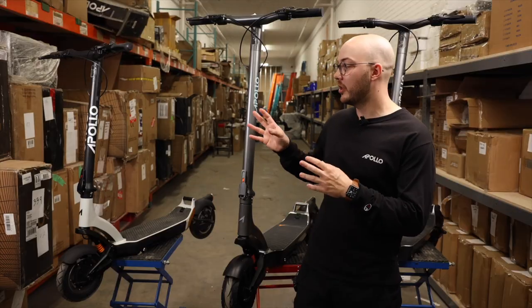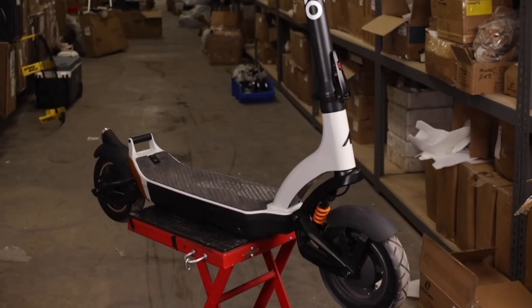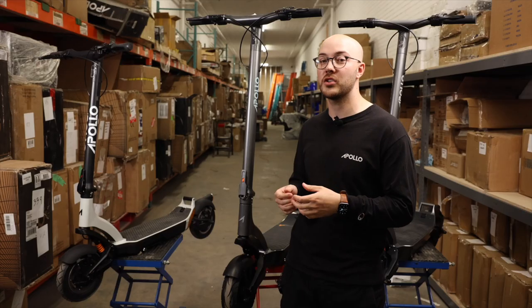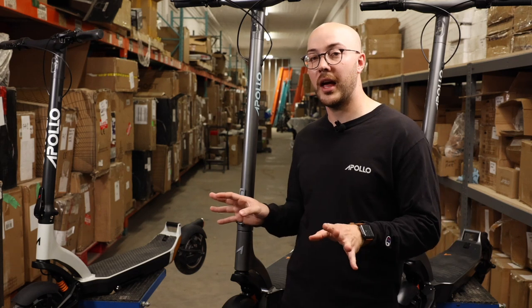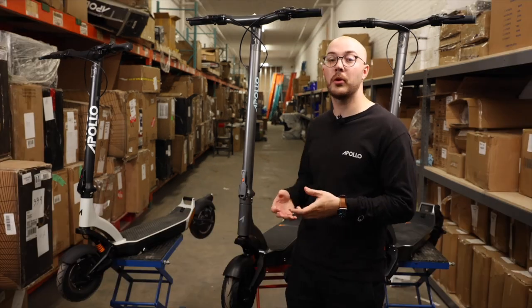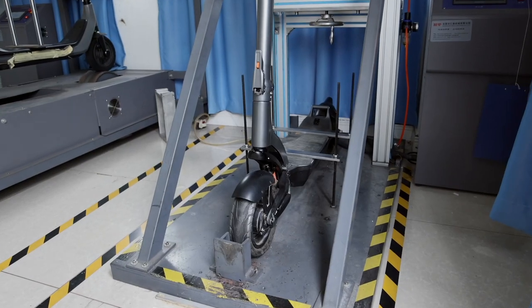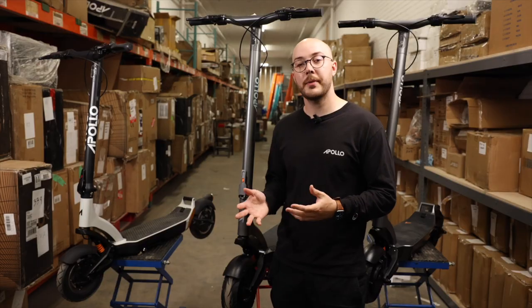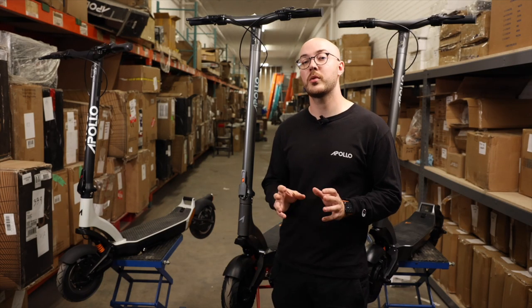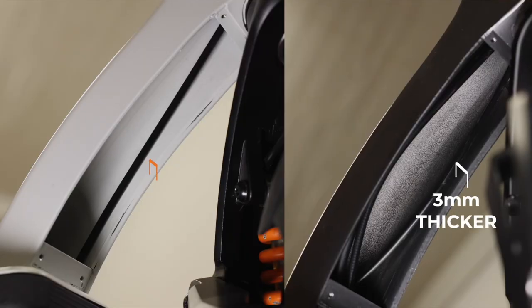If we continue to go down, the next thing is the neck. This is one of the critical parts of your scooter and we wanted to make sure it was ultra strong. On the V1, completely fine, nothing happened. On the V2, we had a couple made and were able to put it on testing rigs at our factories, putting thousands of kilometers on it with hundreds of pounds of load. Despite performing well, we realized there was still room for improvement, so we decided to make it 3mm thicker on each side to withstand anything you throw at it.